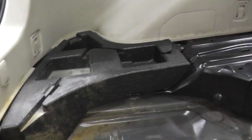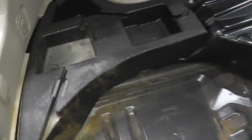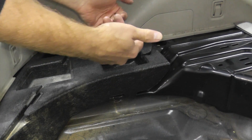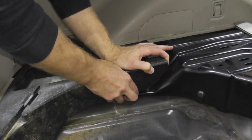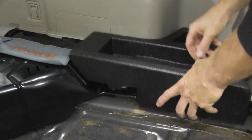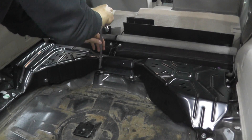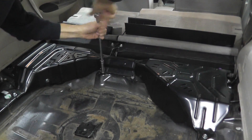Let me show you very quickly. You have a tab here and another tab here. Place your hand where that tab is, because when you pull on this it can jump up and hit you in the eye, so just be careful. First we'll remove the middle plate, held in by four 12-millimeter fasteners.